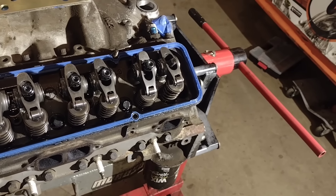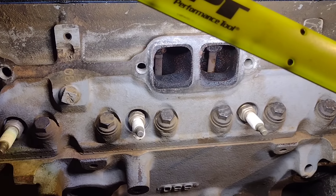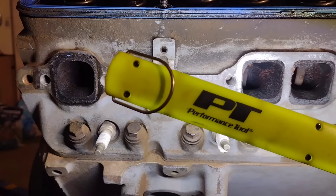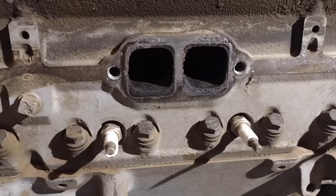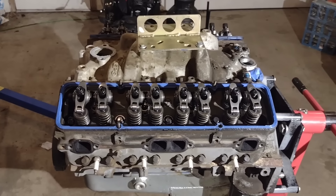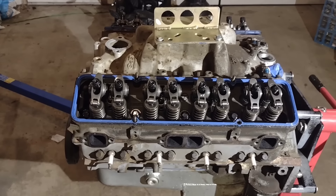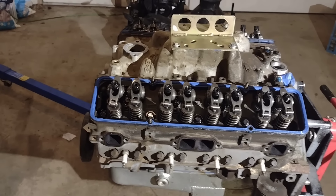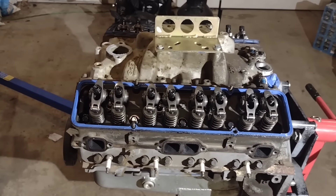In the future we'll have to try to think of a way to mitigate that. Another area - just something to think about that I noticed on simple external inspection - there's a little bit of rust inside the exhaust ports on the backs of the exhaust valves. A good chance that has to do with the fact that we're running ethanol fuel, which tends to carry more water and produce more water in combustion, and also the times the car has been washed and left outside after a night of racing. I think we can mitigate that in the future - currently I'm running positive stop valve seals on every valve, but I think we might switch to an umbrella style seal on the exhaust valves to allow just a little bit more oil to get to those valve stems.